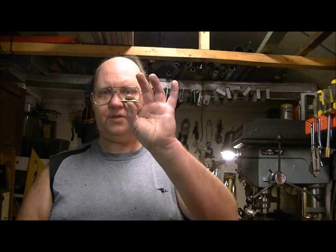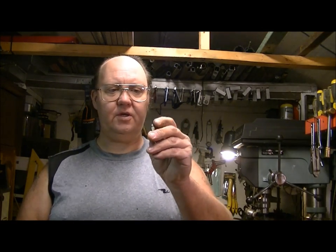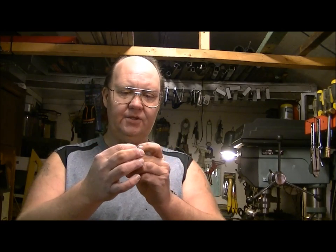For those of you doing some modifications on your air guns — whether you're boring out your transfer port or whatever — you're going to need this tool in order to hold the transfer port safely, especially when you're polishing it and getting rid of the burrs. If you try deburring with deburring tools or sandpaper you're going to whack it out of shape. Even a factory one could use a good polish job — the smoother you can make the edges, the better. You don't want to use deburring tools because they'll wreck it, same thing with your barrel inlet.